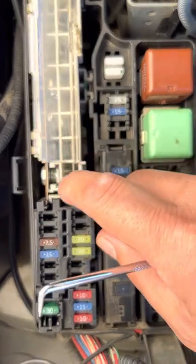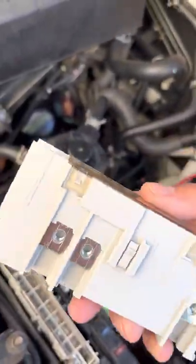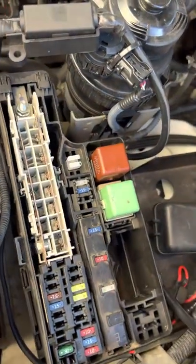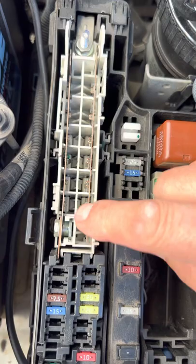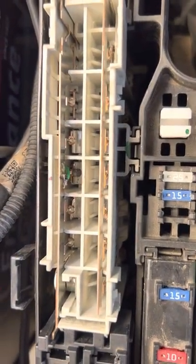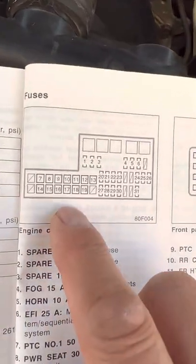As you can see, there's no plastic cover here — it's already snapped. I have a brand new one right here, that's what it looks like with the clips. I haven't put it on yet — I'll explain why in a sec. After taking that off, get your multimeter, or if you don't have one, just look closely at the fourth one from the bottom: one, two, three, four — this one here. There's a green wire. It's number 17 according to the reference manual.